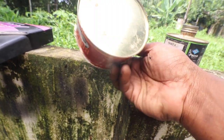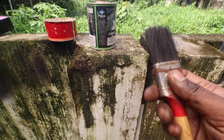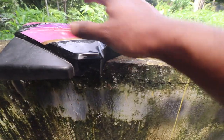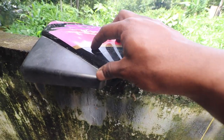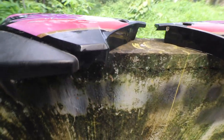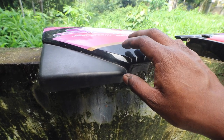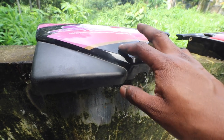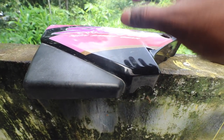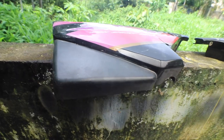I have a metal mixing cup — an old body filler cup I use for dirty work — and a 38 mm brush which allows me to apply this uniformly. Ideally, stickers on an original panel are not buried deep in the clear, so peeling them off is easy. But for something which has gone through multiple painting cycles, this is a pretty thick sticker. It is actually advisable to apply new paint on top of already existing paint because it adheres well, but the challenge is that the sticker is buried under a very big layer of clear.